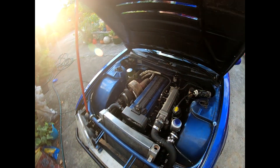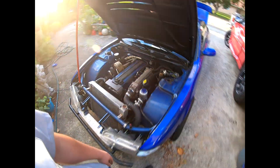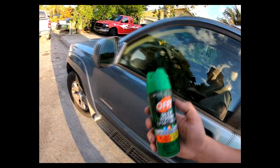I'm waiting for the battery to charge up a bit and then I'm gonna start the engine and see what happens. I think number six cylinder's plug was wet when I pulled it out and it was a bit oily, so it's either the rings are done or the valve seals. The primary reason I'm doing this test is because the car is smoking on throttle and on decel, and the coolant level in the radiator itself seems to be dropping significantly.